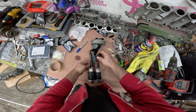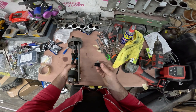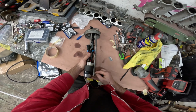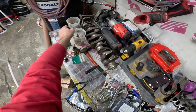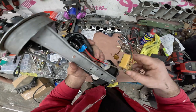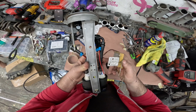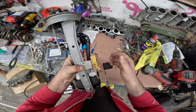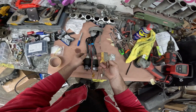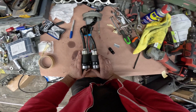I don't have any three-eighths tubing so I might just run a dash-6 line all the way down with a kind of peak clamp — that's at the fuel return. The fuel level sensor goes right on here somehow like this; I've got to figure it out. I believe it goes this way, so we might have to move this over a little bit, or maybe I'll just make a slightly longer bracket and see if it works on the side.